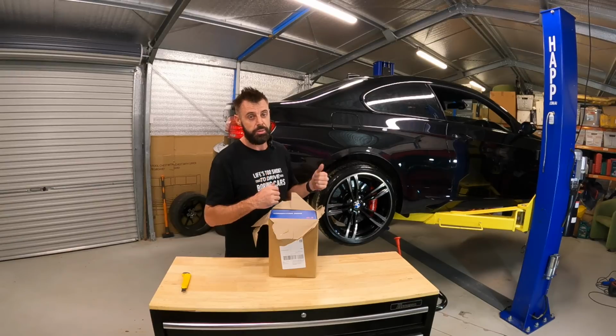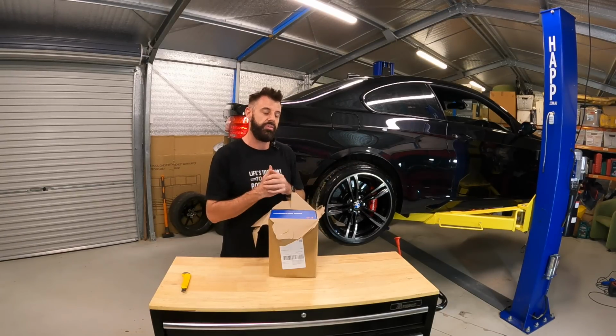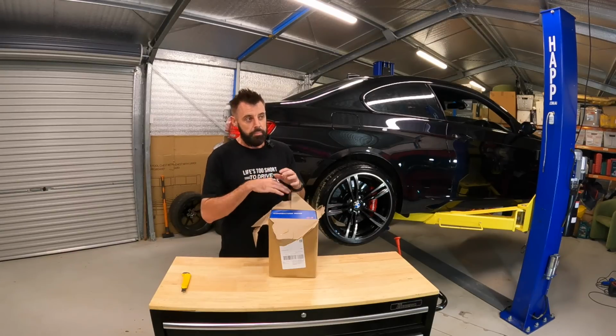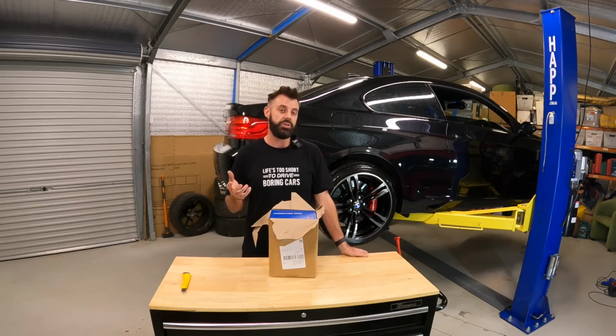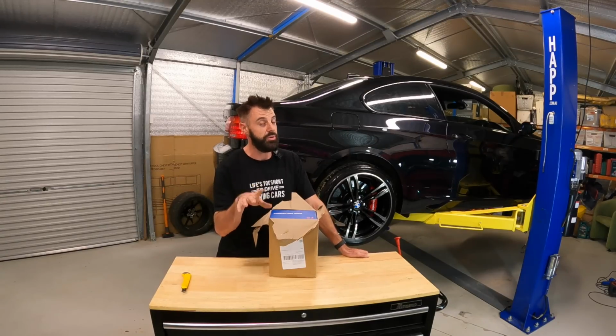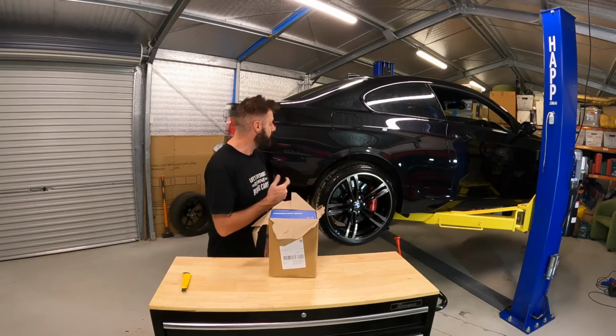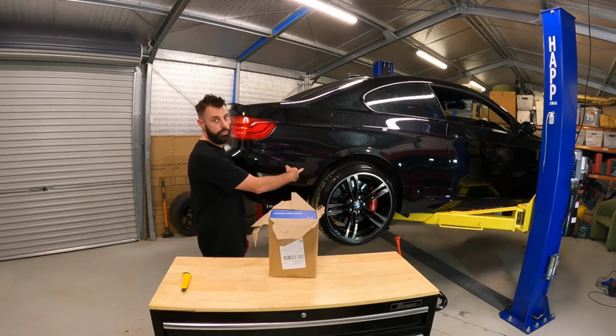So I put the 17T turbos on, the car was fast, loving it. One day, I woke up, took it for a drive, and I could hear a misfire. After a bit more investigation, I'd actually lost compression on cylinder 4. At the time, we didn't know what it was, and I bet there's a few of you guys who never saw the video where we discussed the problem. But it was actually being caused by corrosion on one of the battery wires.